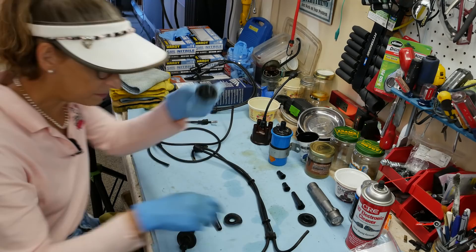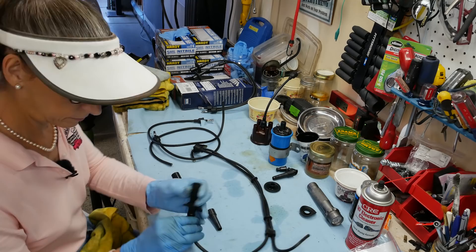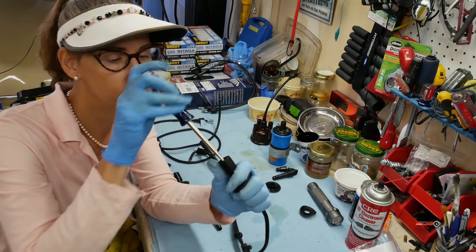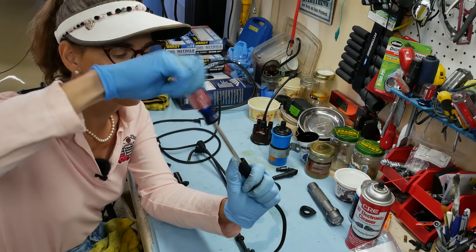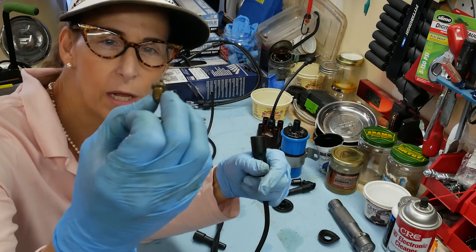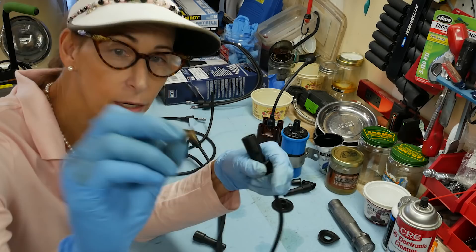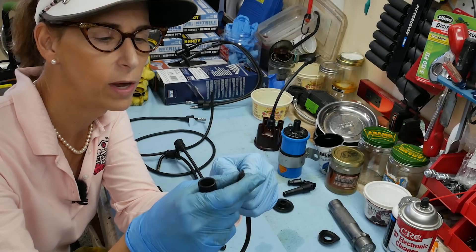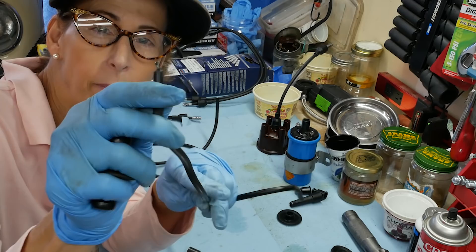In order to get these off, they don't twist — they feel kind of loose, and there's a reason for that. You can use a screwdriver to loosen the plug inside. It's just a little brass plug with a spring to catch the threads on the end of the spark plug. Obviously the wire can now come out easily. It looks like they tinned it as well — that's a good idea. They cut the wire back a little, tinned the very end, pushed it up in there, and then screw the plug back in.